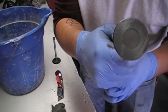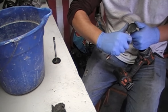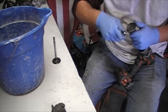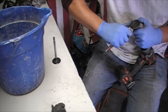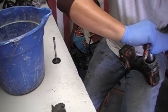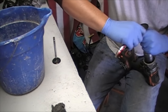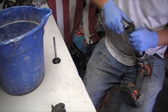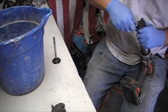So the next thing we're going to focus on is the bottom here. Like we did in the beginning for the heavy debris, we're just going to take our blade and slowly scrape off a little bit here on the bottom. You don't want to dig in too deep, but as long as you keep on this surface here, this isn't a sealing surface, so it'd be okay. You just want to go around and scrape off all the heavy carbon, because carbon attaches to carbon and grime — carbon doesn't have anything to attach to and it won't stay; it'll go out your exhaust valves.